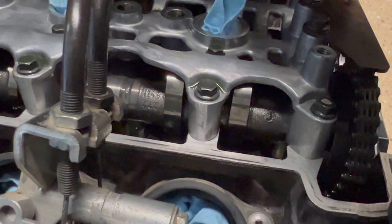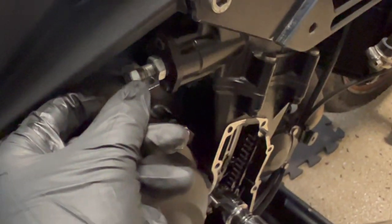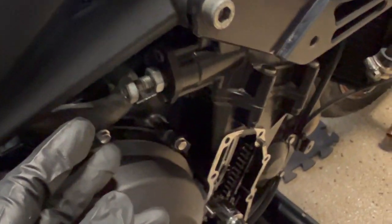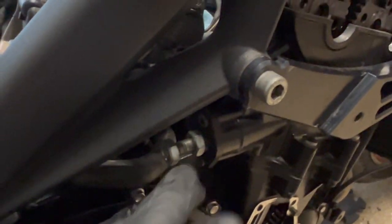And then if we need to make any adjustments, we are going to have to untorque this, again, in that specific torque pattern order. We're gonna have to pull the slack out of the cam chain. If you have the original cam chain tensioner, you're gonna just need to remove that. Be sure to get a new gasket for this if you have that. If you have the APE, you can just loosen it up, take the slack out of the chain, but everything's gonna be out of time.